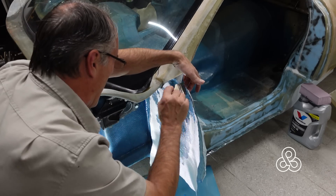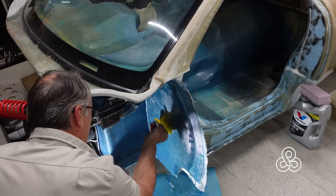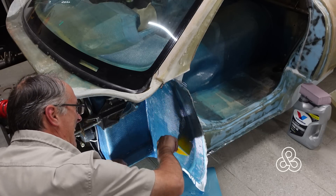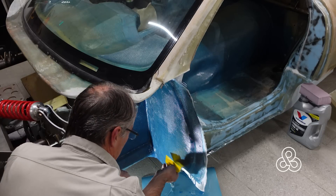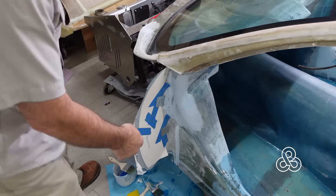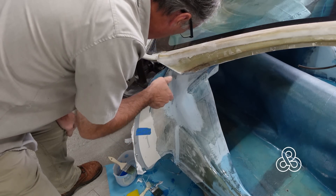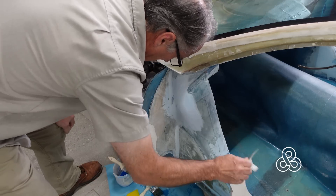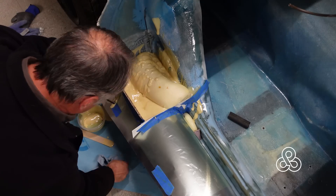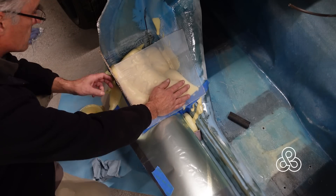This extension we just created in the template goes right up against the door skin. It will be trimmed back the width of the rubber seal in the end. Now we're getting close to finished products on these things, so I'm taking a little extra care to make sure our laminations are nice and smooth and pretty in case nothing else goes on there — when we get a finish on there it will look nice. Once that's hardened up next day, we go back in and pull that template right off, then use some solvent to clean the wax off the foil tape. Now I'm going to pour some foam into a little form I've created right up against that panel to create that perpendicular piece — just some cardboard and tape, very rough, because we're going to pour some expanding foam in there and just let it go.